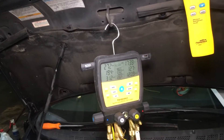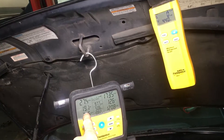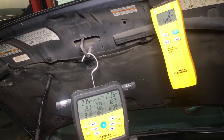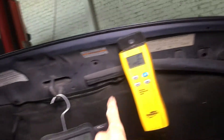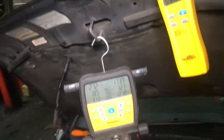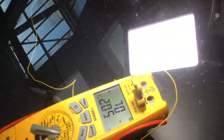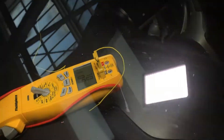I was at 30-31 psi on the low side with 270 grams; now we have 450 grams and we're at 27 on the low side. Before it wasn't cooling — it was barely cooling — and we're at 50 degrees right now, but this is only at idle.